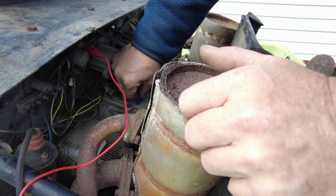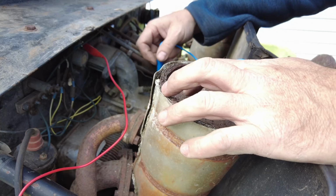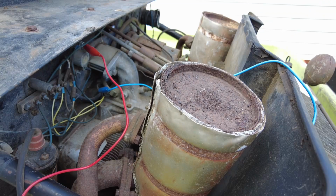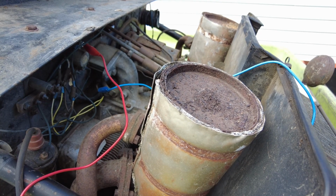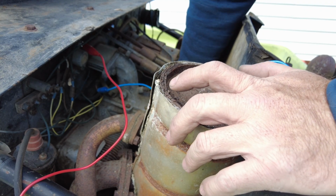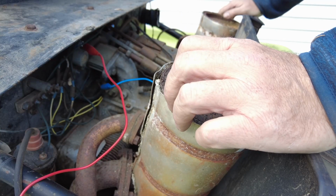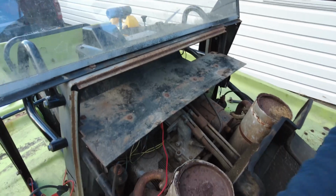I don't know whether you guys are hearing that, but I'm getting 0 ohms when I short from the ground point I'm using here down to the top of the block. So we'll clip on to our points lead, such as it is. And we're showing 4 ohms right now. As soon as I take the power off, still showing 4 ohms resistance. And as I turn the engine over off of the crankshaft, I'm not seeing any difference. So that tells me that we're probably shorted out somewhere along that wire, given that the insulation is all peeling off. That's not good.